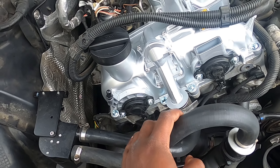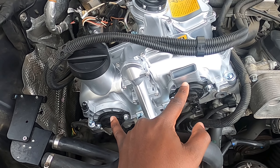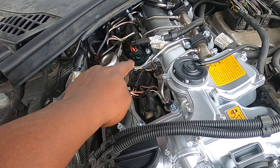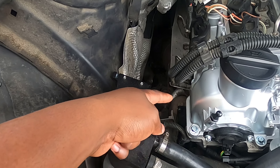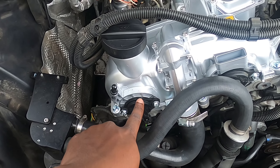To identify which actuator is intake and which is exhaust: air comes into the intake side here, and this is where the eccentric shaft actuates the intake. The exhaust side is where the exhaust manifold is — it controls exhaust timing.